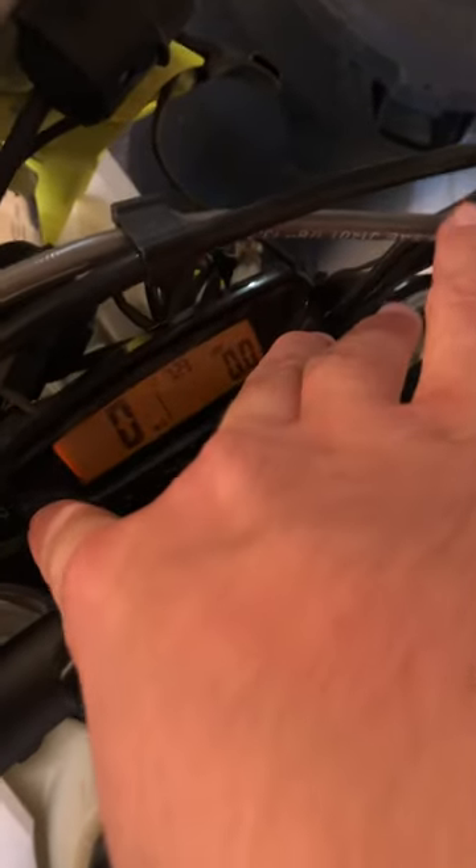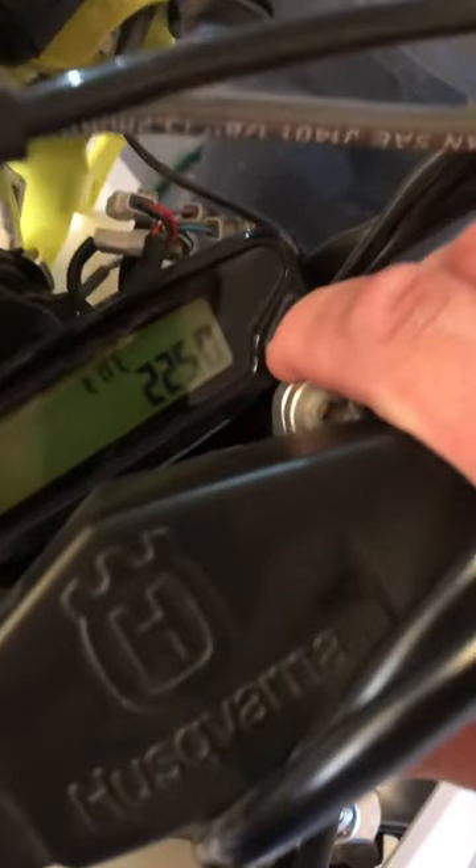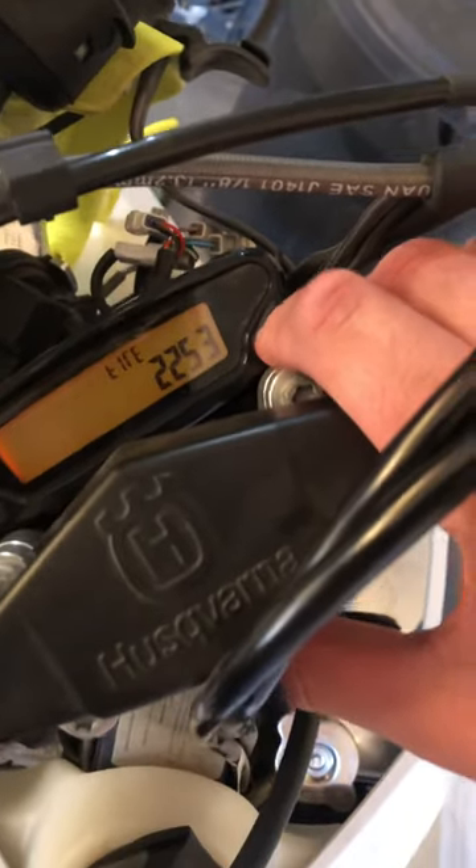Come over to your computer unit and clip it to wake it up. Then hold both buttons for a few seconds and you'll see it change displays. That first screen says the unit — miles per hour. The next one says tire size.